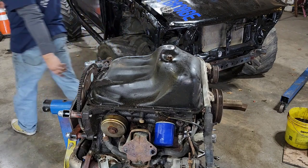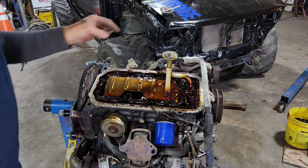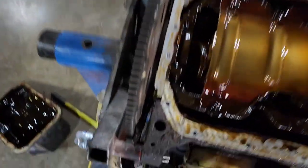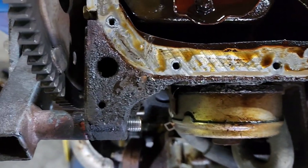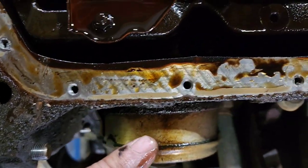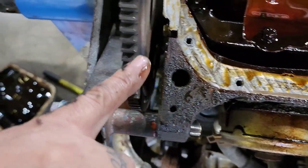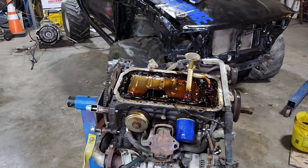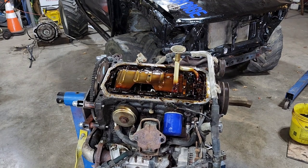We've got a little bit of silicone, and that's just silicone. You can see on this edge here where all that is wet — over here it's not out to the edge, but over here it was wet all the way out past the bolts. That just meant their sealer wasn't consistent — like there it was leaking, there it was leaking. That's how you know your gasket was leaking for sure when you take it off, and it is time well spent. So clean that pan out real good, give this rear main a good inspection, and then put the pan back on.